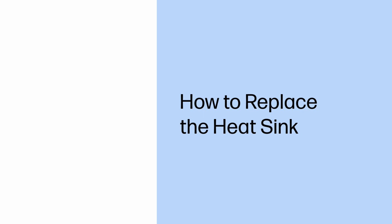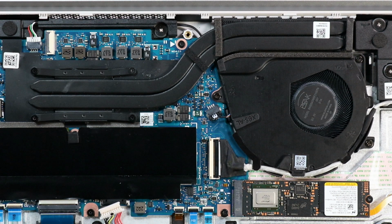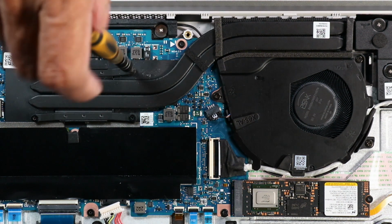How to replace the heatsink. Before you begin, remove the base enclosure and disconnect the battery. Removal. In the numerical order indicated, remove the four P1 Phillips head screws that secure the heatsink to the system